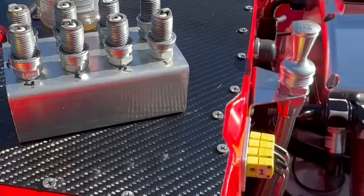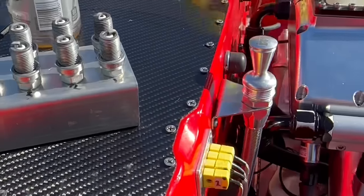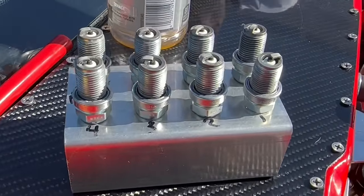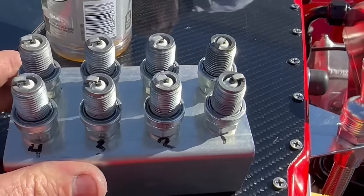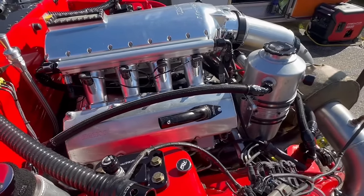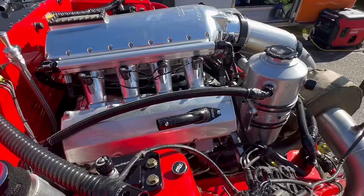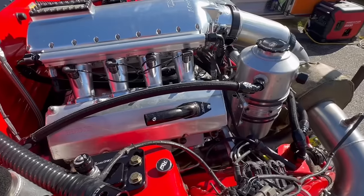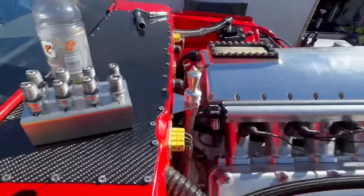I think we're going to drop some fuel out of it and lean it out some more. So maybe our O2 sensor is reading correctly and functioning the way it's supposed to. Instead of targeting 3.2, we're going to target 3.4, and take a little bit of fuel out of it, try to get maybe 3,800, 3,900 pounds of fuel. I have no idea what miles per hour we ran, unfortunately, and we don't know what the ET was. It went 2.91 to the half track. That was about what we went last night, 2.91 or 2.92, with a 1.16 60 foot. But we had a bunch of timing in it, and a lot of fuel in it.